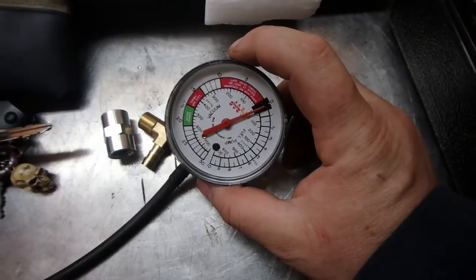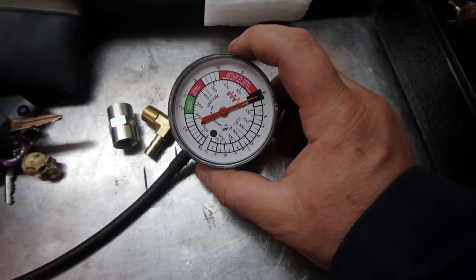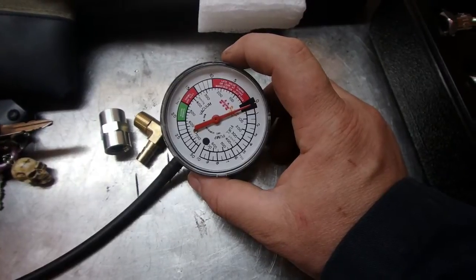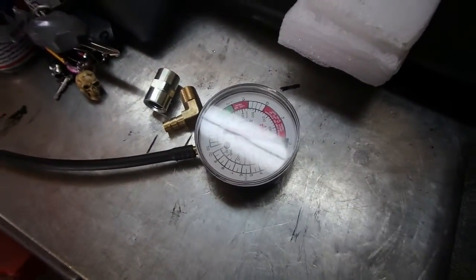This is how it's going to work. If I'm turning over the engine by hand and I'm reading pressure going all the way up, then all of a sudden it hits zero — when I start reading vacuum, I've gone too far. Then I just reverse the direction I'm cranking the engine until it hits right around the zero mark, and that'll get me pretty close if not dead on top dead center.